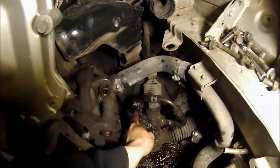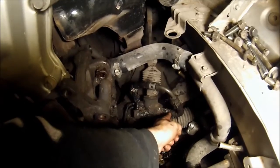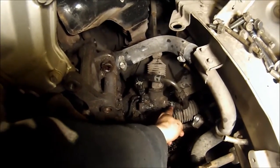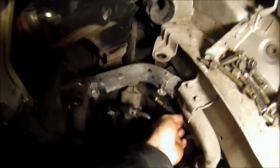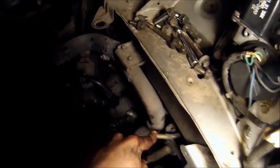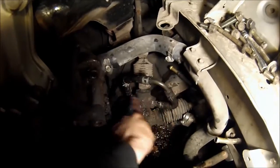This is the hose that I cut off of this side, and remember I was cutting on this side? Well, I got that cut, and then this was the hose that was originally running to a line over here, and the hose that was running from this line to the power steering reservoir. I used both those lines with the metal line in between and connected them in the loop. And that's how I looped that.